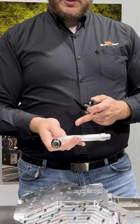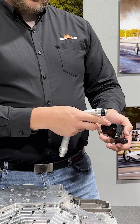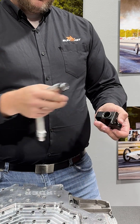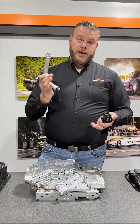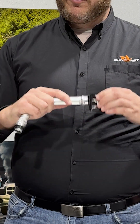On the longer side of this filter suction tube, go ahead and remove your grommet and install it in the port at the front of our billet block. A little bit of ATF or even transmission assembly jelly helps this portion of it. Go ahead and take the new suction tube and gently slide it into our billet filter block.